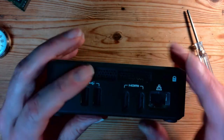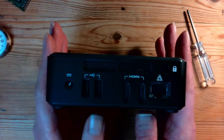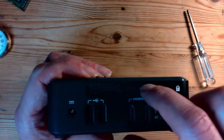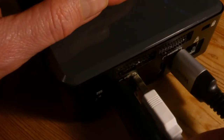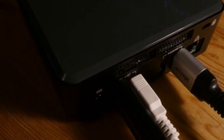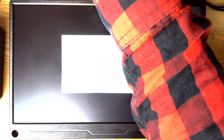I'll show you something I don't like about this model — these grilles here. When the aluminium chassis slides up, it really bends back these metal grilles and it just looks ugly. I've hooked up a mouse, keyboard, and HDMI cable, popped in a USB booting stick. I've installed Ubuntu using UNetbootin to create that particular one. Before I hit the power switch, I'm just going to start tapping F2.